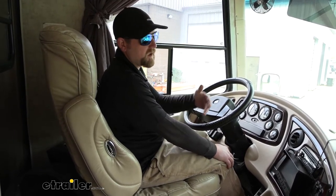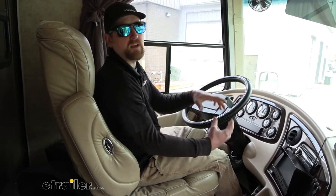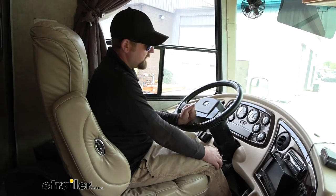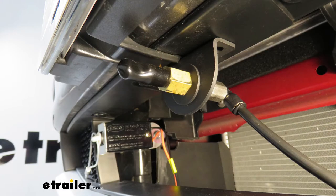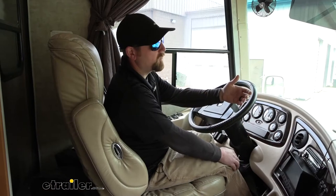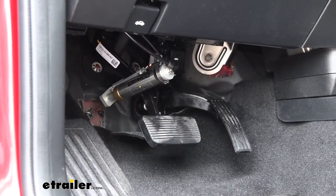In terms of what this side's actually going to do, it's going to tap into your motorhome's air system. There's going to be a small tank, almost like a reserve air tank, and that's going to be full of pressurized air when you're flat towing your vehicle. Whenever you apply the brakes in the motorhome, that tank is going to disperse air — shoot air back through the lines and fittings into the Air Force One on your vehicle side — and that air pressure is going to hit the brakes in your towed vehicle so that everything comes to a safe stop.